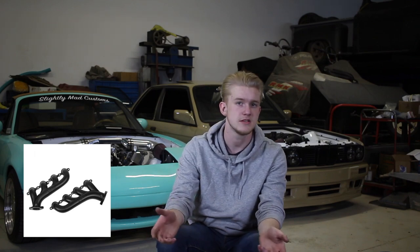For your exhaust options, your choice is going to depend on whether you want a good affordable LS build or want to squeeze every possible horsepower out of that LS block. For the most affordable option, you can get some Pontiac G8 exhaust manifolds — this is what Monster Miata includes with their kit. They're definitely not going to be the prettiest or best-flowing exhaust options, but if they get your car on the road, that's a great start. Your next step up is to get some shorty swap headers from Sanderson. These are only 1.5-inch primary, so they're not going to make a whole lot more power than the manifolds, but they do flow better. These are available on Sanderson's website — you just choose which LS block you're using and whether you want it coated or not.